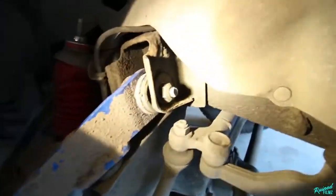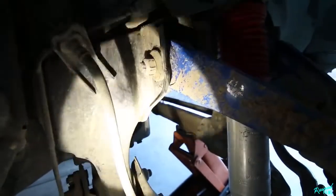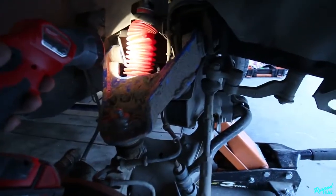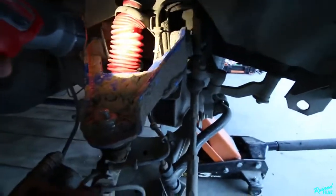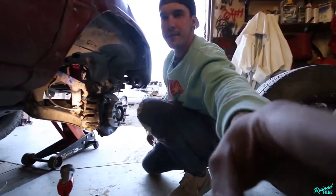So this right here is what I'm talking about — those are your camber bolts for the upper control arms. What we're going to do is loosen that nut and stick a 22mm socket on the inside of these control arms and just turn them. They're kind of an oval shape, so as you turn them it'll either pull the control arm back or push it more forward. We want to try to knock the camber out of the wheels, so we'll rotate them towards the truck and that should take the camber out.